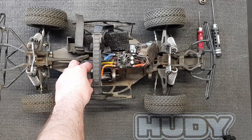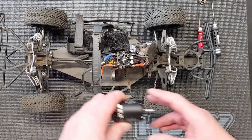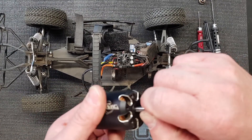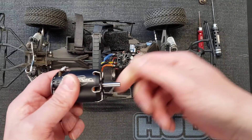We have unsoldered the motor. I also had to remove the servo just to make it easier to get it out, and the motor then comes out like that. I can't even turn the shaft on it, so obviously there's some problem with the motor — we'll take it to bits and see what the problem is.